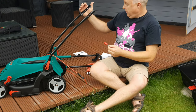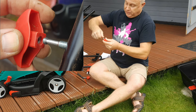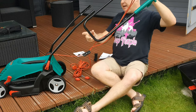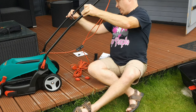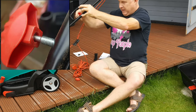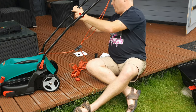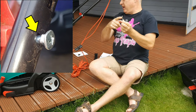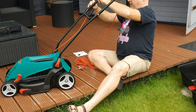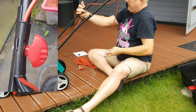There are two bolts and toggles that hold the upper handle to the lower handle. The toggles are captive on the bolts but you do need to undo the bolts out of the toggles in order to put it together. Pull a bit of extra cable out so the bulk of it remains on the floor rather than dangling and working against you. Slot the upper handle between the two lower handles and from the outside inwards push the bolts through your chosen adjustment slots. Screw the toggle back on all the way and just nip it up — repeat on the other side. Note that the bolts have a square section which goes into a square hole on the outside, and tighten by hand. Separate the lower handle from the upper handle, lift the cable into the middle, put the bolt through catching the cable bracket, and put the toggle on.